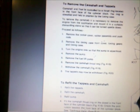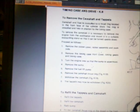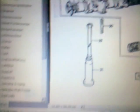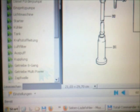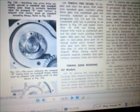The reason for inverting is that if you try to remove the camshaft without inverting the engine, the tappets will fall into your oil sump — and that's not the best case, that's the worst case. I also have the parts manual, and you can see the tappet here, and on top is the push rod where the rockers are connected. The tappets are inserted from below, not from the top side, and that's the reason why you have to invert the engine.